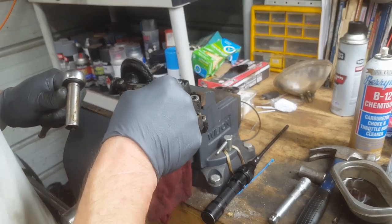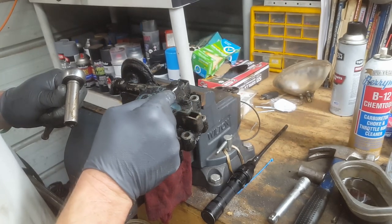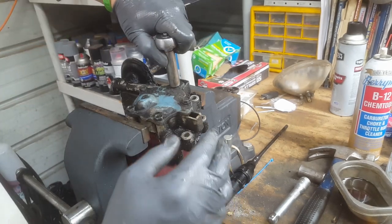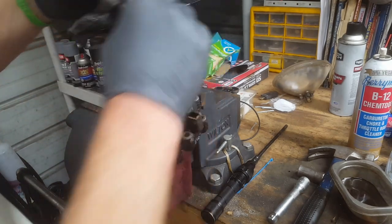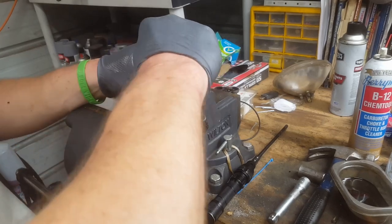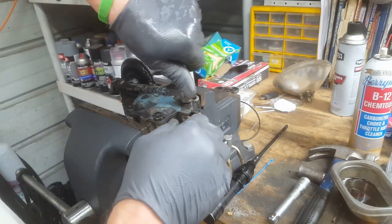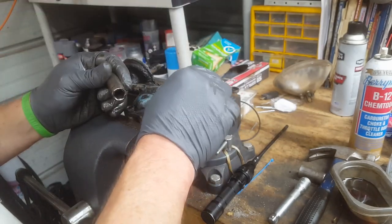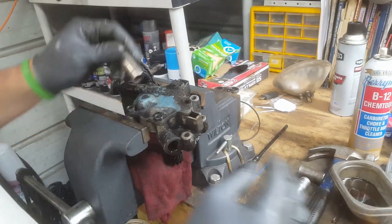That's the Slant Six for you. Gotta love them. The right side of the engine is just always caked with all kinds of sludge and everything. So I don't normally like to use the impact on stuff like this because I just don't. I like to just run stuff out by hand, because you can feel it and kind of tell that something may not be feeling exactly right. So I think these are all the same. I'm going to leave them in order, though.